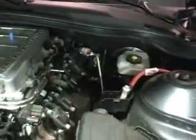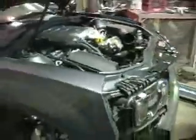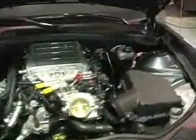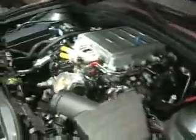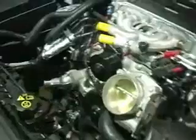We're red labeling in a clutch from McLeod. We sent them the factory clutch and pressure plate out of here, red label, and then Robert Roberts in turn, they did a lot of measurement and they put us together a clutch, and so they're red labeling it back in Saturday delivery, and so we're going to work this weekend and fit the clutch and the transmission tomorrow, but it's really looking good. So the only thing we want to know is if the clutch will hold it. Robert said that it would hold up to 750 horse or so, so we should be good on the clutch. So I think everything's going to bolt together and really fit good.